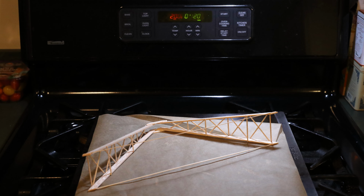You might be wondering if there is something we can do to get closer to the dry sponge analogy. The answer is yes. It turns out if you bake your device in the oven at 200 degrees Fahrenheit for 20 minutes, it removes almost all of the water. I'll demonstrate that here. I like to put the device on a cookie sheet with parchment paper.